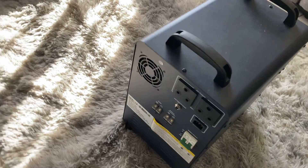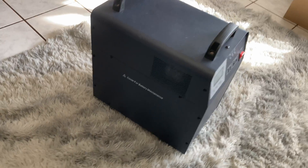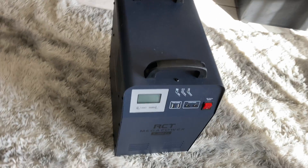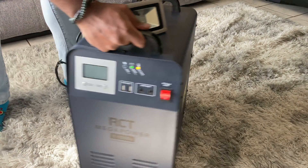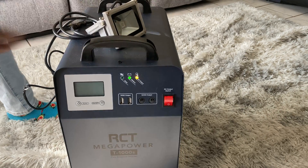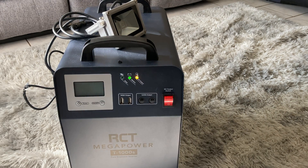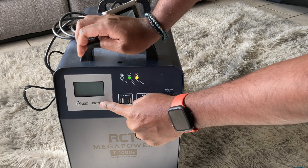I've been using this for six months or so with no issues — they're incredibly silent. For the first four months or so it was fine, but in the past month and a half I've noticed the fans blowing incredibly loud. This doesn't strike me as a surprise: dust gets into it, it can't cool as efficiently, so the fans have to blow faster. Just keep that in mind — after about six months to a year it starts getting louder than when you initially bought it.